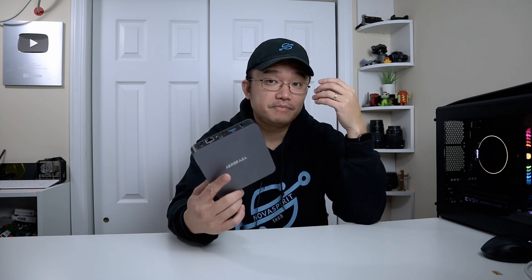The good and bad side of mini PCs is that while they retain a very small footprint, there are limiting factors in what you can do and what you can put into them. On this one in particular, the RAM is soldered on so I can't upgrade it, but there is a slot for the SSD, so you can actually replace it with something much bigger.